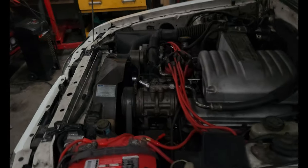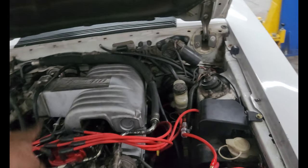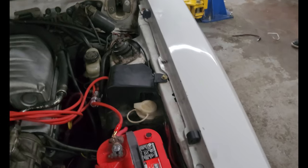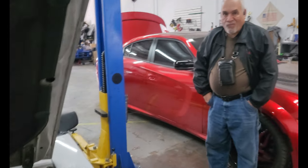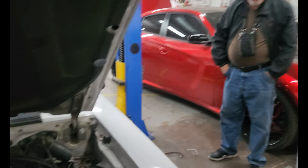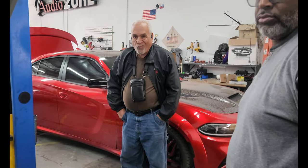Romain Pierce, up in the building — owner of the beautiful 5.0 Mustang. Got a couple of things I'm going to walk him through. You already know everything that's in there: you got the MSD, you got the wiring, everything's done in the car. I'm going to get her washed up because I don't like the way it looks right now — she's dirty. Battery's done. We added all these extra wires to do a big three because you have a lot more compression than you did before — sitting at about 180 a cylinder when it's cool. So it's definitely a different ball game when you're turning her on. She's going to turn on sometimes fast, sometimes a little bit slow because she's going to let her hike up, especially when it's hot. But let's turn on the car.